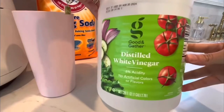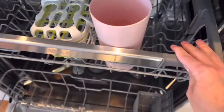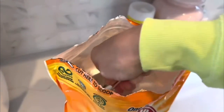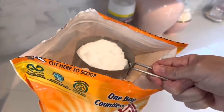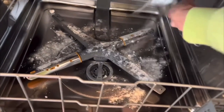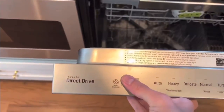You're going to do two different washes. The first wash is with white vinegar — just fill up a cup and place it in the top rack of your dishwasher. I put mine on heavy duty to make sure everything is really getting cleaned and descaled. That's going to take a few hours. The second wash: take a cup of baking soda and sprinkle it generously in the bottom of the dishwasher. It has good abrasion to remove any remaining debris and get it shiny and clean. Put that one on normal, and once that cycle is done you can see how sparkling clean the dishwasher is.